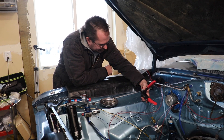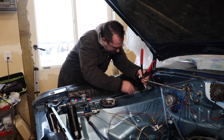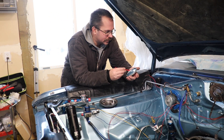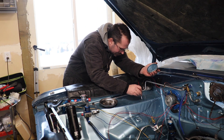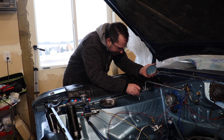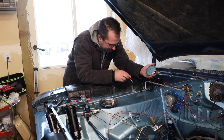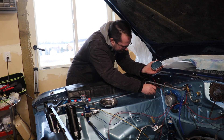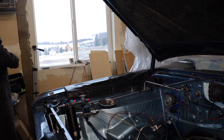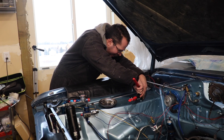The problem is I want to do some rust preventative before I set these. Rust proofing is as easy as leftover paint from the car - simply coat a little bit. Some of you live in an area where maybe this isn't a big deal. Reality is, a car like this, it's not going to be out in bad weather that much anyway. But I want to do it. And I'm going to set these before the paint is totally dry, so I'm not chipping it off.